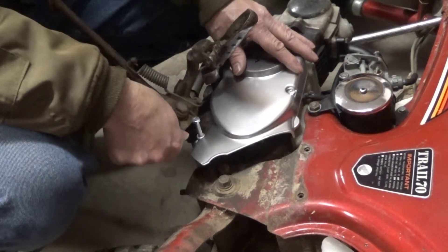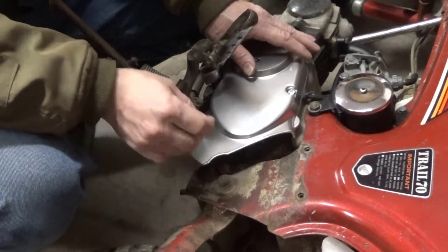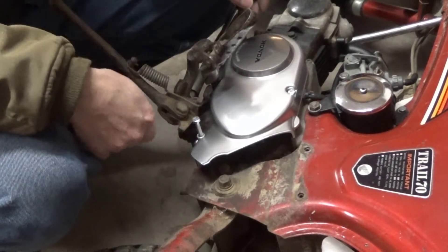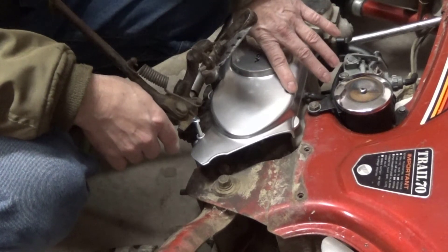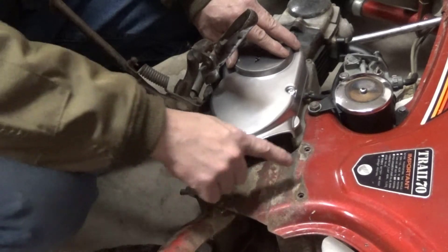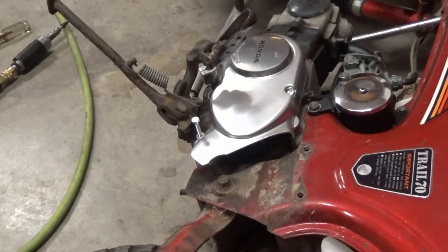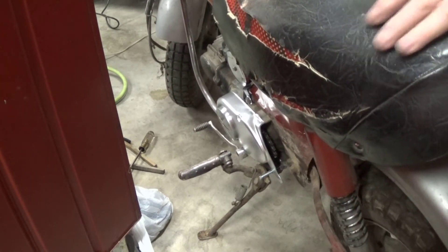I'm being careful because all I've done is push that thing in with my thumb and rasp out the hole — no tapping with a hammer. You can tap it, but you remember you can crack something. You don't really have to force it. Just rasp out your hole a very little bit at a time until you get the insert to fit. What I'm going to do now is set the bike up and crank it with the kickstarter just to make sure the magneto is not dragging on the side cover. The chain guard has been flopping around because this has been broke for some time — those are the two bolts for the chain guard. I'll turn it over with the kickstarter — no dragging. We are good and lined up.